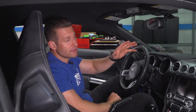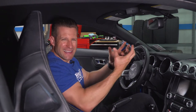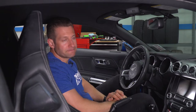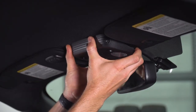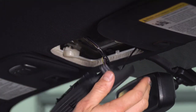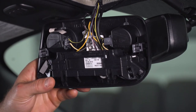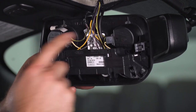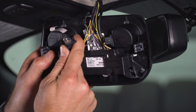With the map lights, pretty easy to do. We just have to drop this housing — it's held on by a couple clips. Give it a firm tug and it should come down. With the housing dropped, now we can access the two bulbs we will be replacing here. They're right on the other side of these plugs — basically just grab it, give it a good tug, and release it from the housing.